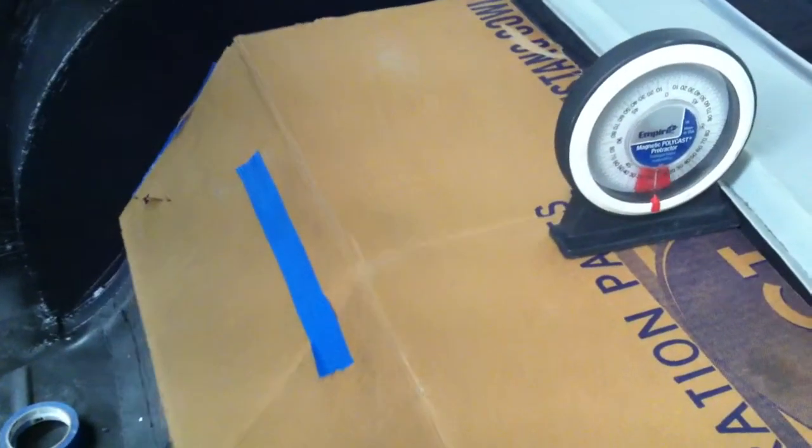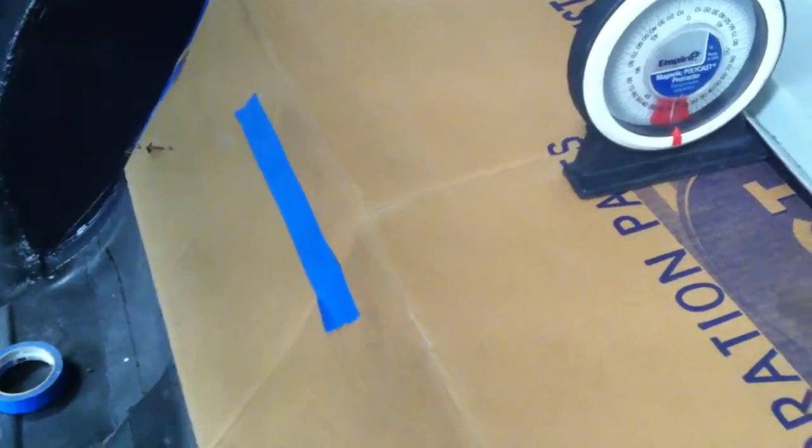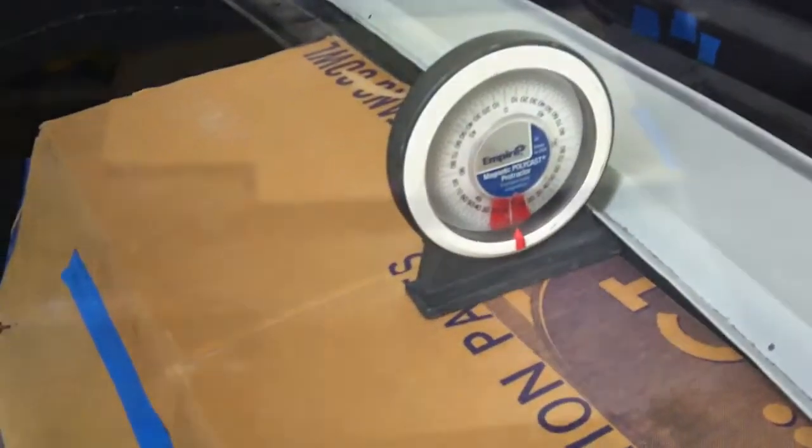Here is the cardboard — you can see the package tray has a bend and an angle on it. We used a joint in the cardboard to simulate that and matched it up to get the right angle on this bend, using our protractor to match up to the level of the rocker panel. We took that template, put it onto some 18 gauge cold rolled sheet metal, and cut it out. This represents one half of the package tray. We need to put a bend in this, so we'll draw a line across and take it to the chassis shop to use their brake and put a perfect bend in — matching up to that 90 degree bend where it makes the transition down to the floor pan.